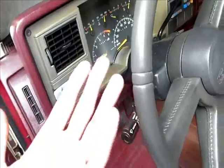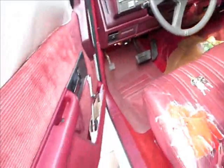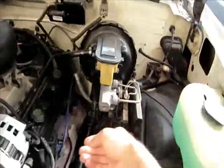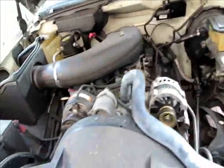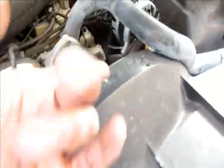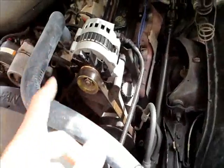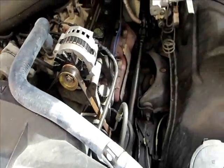What you should also do — though I don't always do it — is disconnect the battery to reset the ECM, because it goes back to its base timing map. When you set the timing, sometimes it runs pretty good for like 200 miles, and then 200 miles later it's back to the same old thing. This thing has been having timing issues — new chain and everything — and it still moves around. I don't know what it is unless that bolt hole is really wallowing out, expanding when it gets hot, and the distributor slips back. It wasn't that retarded — maybe one to two degrees — but that's enough for it to feel pretty sluggish. At zero degrees, these engines feel really sluggish, so I usually bump them up one to two degrees and it helps a little with the performance.